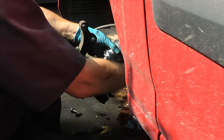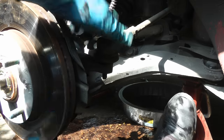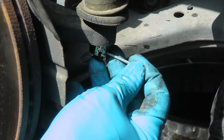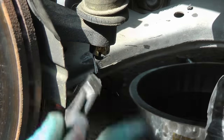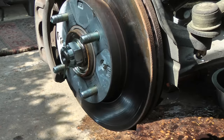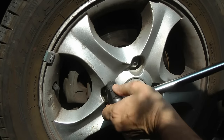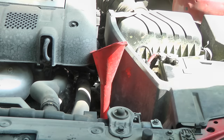The end slips into the hole and slides into the hub. Then you put the nuts and bolts back on and hold the strut to the assembly nice and tight. Put the tie rod back in, get a new cotter pin, stick it in the hole, and bend it back so it doesn't fall off. Get the axle nut on nice and tight, stick a new cotter pin in there too, and bend it back over. Put the tire back on with the lug nuts. Then check the transmission dipstick and put the fluid back in that leaked out.